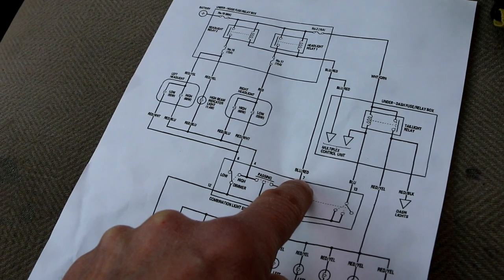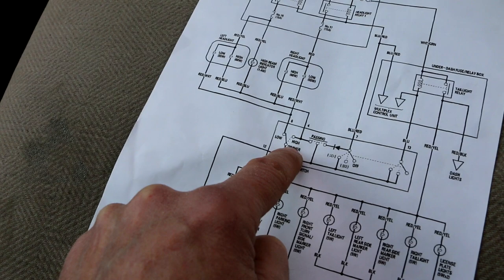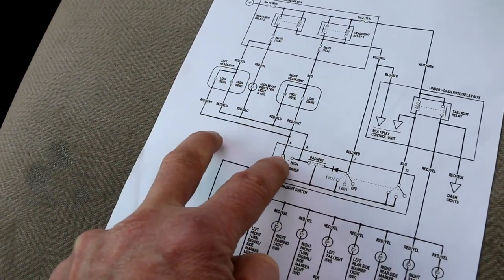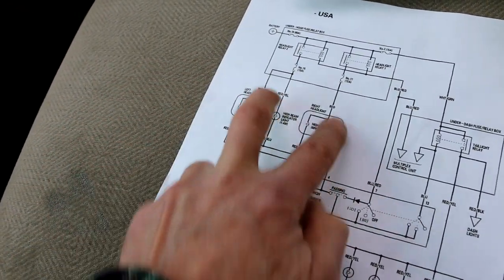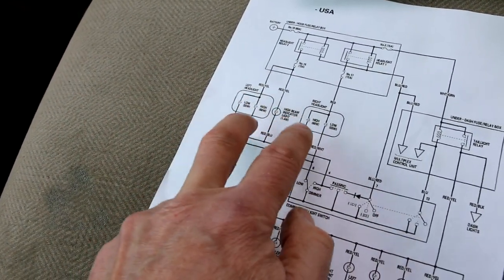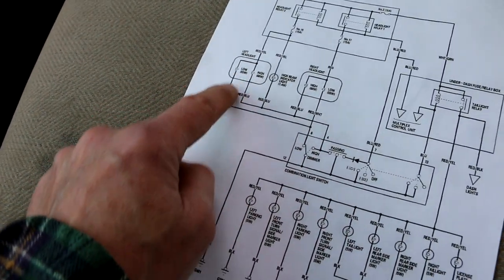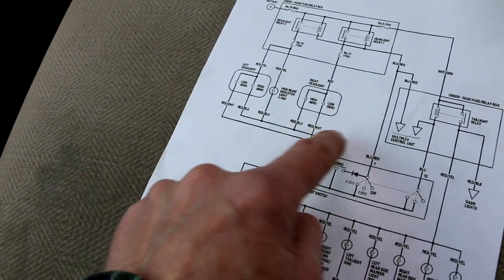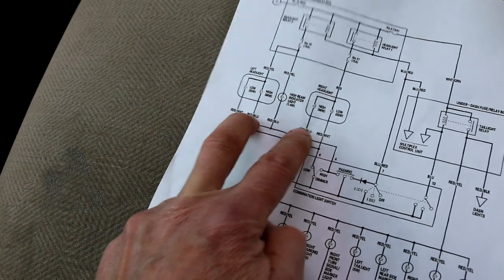Whether it's low beam or high beam is actually decided by this switch, the low high dimmer, which is on the other side of the lights. So when these relays are energized, 12 volts is being fed to all of these filaments at the same time. And you're like, well, how come not all the lights light? Well, because we have to complete the path of current flow by sending something to ground. So we tie together the 2 low filaments and the 2 high filaments.